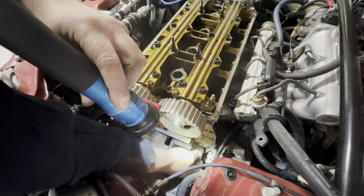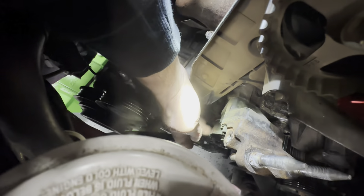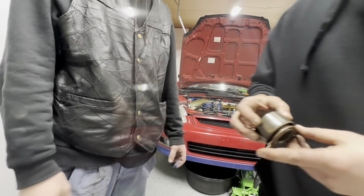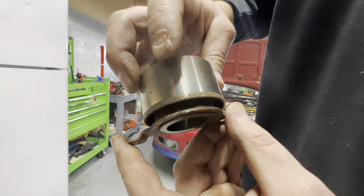That's what we're going to be replacing - brand new timing belt. We've got to take the tensioner off. From Honda we just bought the belt. Touch the tensioner down here - there's your tensioner. I'll take it off right now and show you guys. Looks like we're going to need a new tensioner - it's pretty corroded. You guys could hear that.